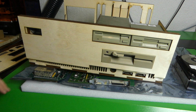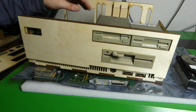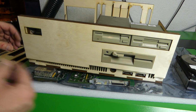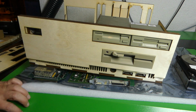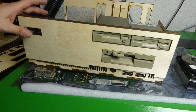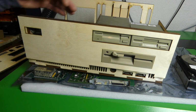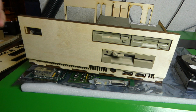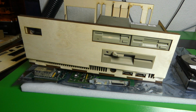The next thing that I have to do is go out, get a small form factor power supply, and convert it to Amiga wiring. I have a power supply that came with the tower. That's already a conversion, and I'm just going to redo that with a smaller power supply. There will be some difficulties involved since the new power supplies have a 3.3 volt rail. I'm going to have to put a passive load on that just to make sure that the thing is working correctly. But I think all of that can be figured out, and it will be the next step. And yeah, I'll keep you posted.